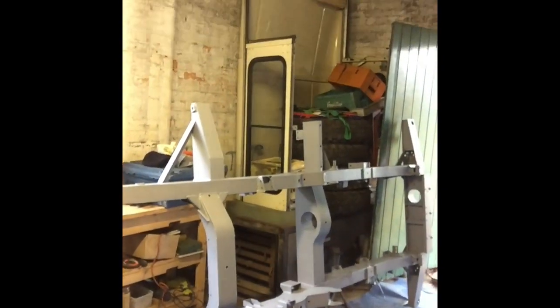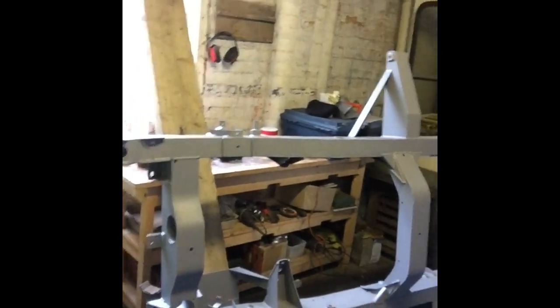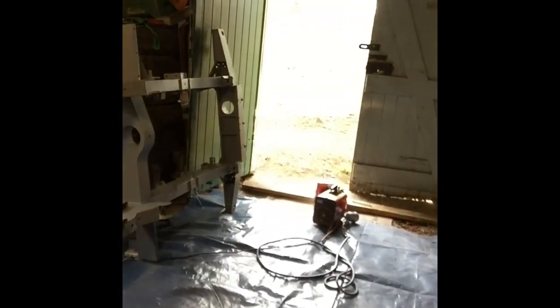I've just painted the chassis with the etch primer. It's grey obviously, and I had to move the chassis against the wall and flat on the floor on different sides just so I made sure I got all of the corners and nooks and crannies. It went quite well. You have to use 20% thinners on the etch primer - sometimes I misjudged it and put a bit too much in and it started to run quite badly on the chassis, but it doesn't really matter because it's a bottom coat.